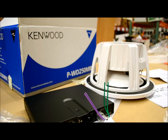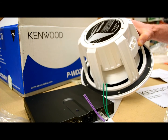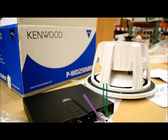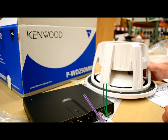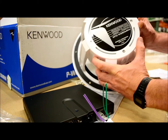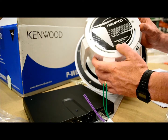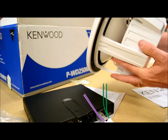I would not recommend wiring this any differently than the factory does, because if you lower the impedance I just don't think this amplifier could hack it. Don't mess with it — leave it be. If you want more power, get a bigger amplifier, because in my opinion this woofer, the KFC-250MRW, will take much more power than this amplifier can provide to it.